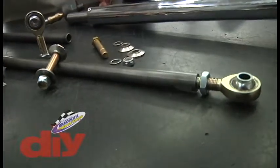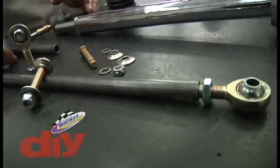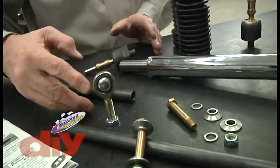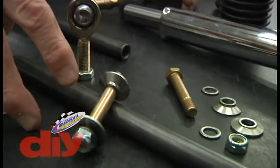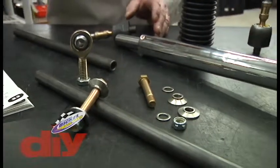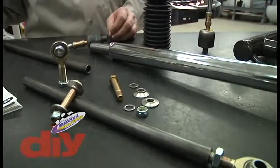Racks are available by themselves, or what we call packages, and the packages can include the tie rods, the rod end hardware to connect to the strut steering arms, as well as all the aircraft NAS bolt and nut hardware, misalignment bushings, and bushings to help you adjust when you go to line the car for bump steer.